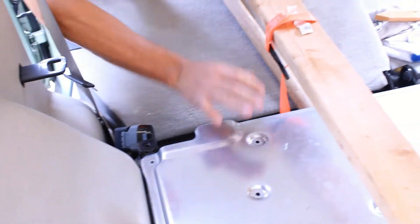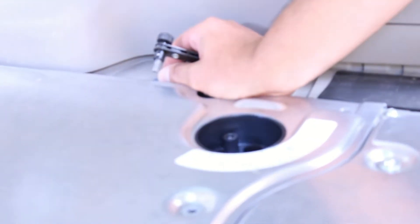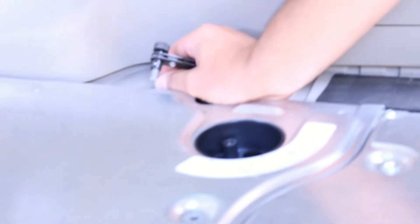We've got a strap going from the 2x4 all the way underneath the battery pack. We've taken all the perimeter bolts out, the top bolts, and then there are two hex heads. Here's your 6mm hex drive head — you don't need the security bit, that just came with the kit. This bolt goes inside, so you can do all the surface stuff, but you still have to lift this out. That's why most people remove the battery system from the car to get to these side ones, but once you lift it to a certain point you just have to get over the lip.